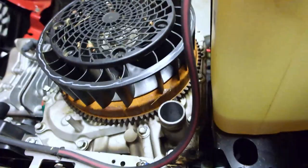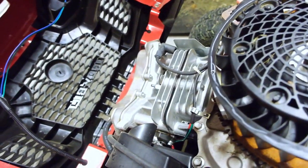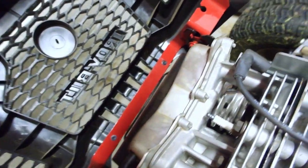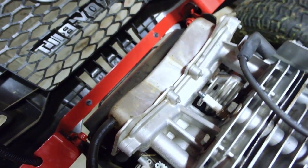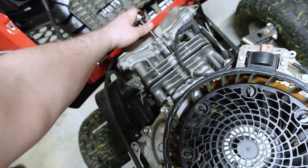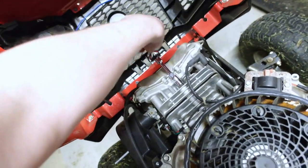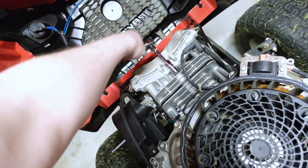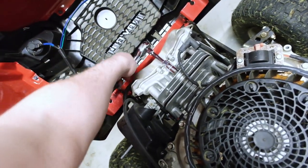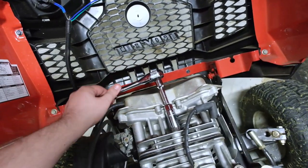Getting up in front of this engine, it's pretty basic. Here's our air intake up here — a little dirty, clean it off while you can. This is where oil goes, so we really don't want to get anything in there. Over here is the engine with the fins to cool it down. And then all the way up here, that's the spark plug — kind of a pain to get to. 5/8s — that's what it takes to get this bad boy out. If you have a little extension it'll probably be easier. Just gently work it. Don't crank on this, don't get a big bar. Also, I don't have the battery in here right now — not even connected — so we don't have any risk of this potentially starting on us. That's something you should be aware of.